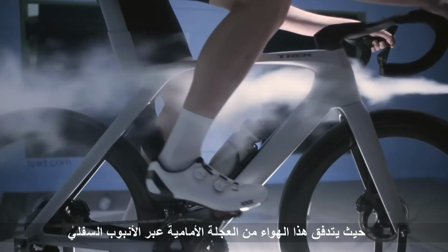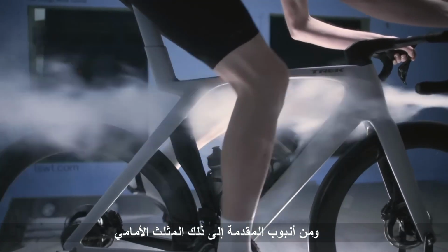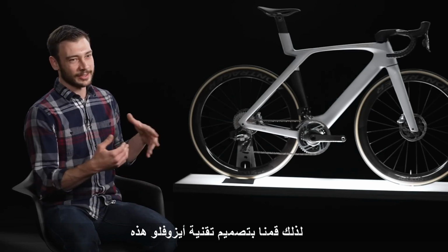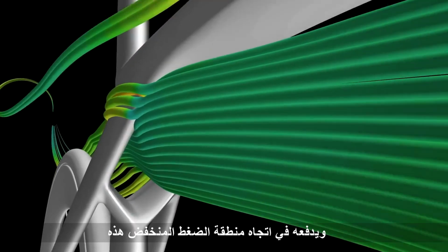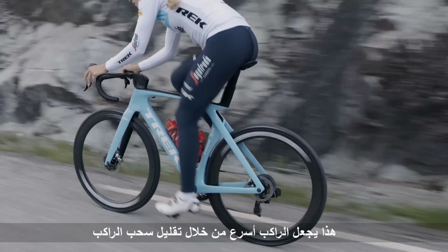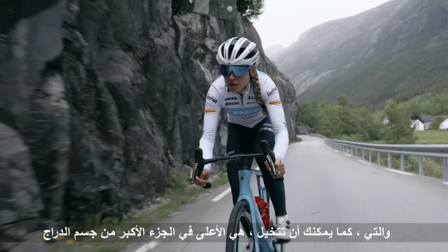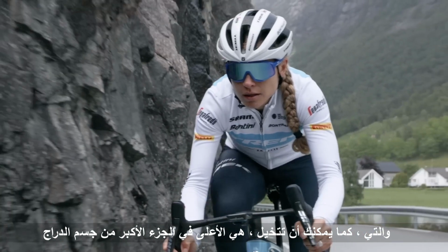As that air flows off the front wheel, over the down tube, and off the head tube and into that front triangle, the air is very turbulent in that region. So we designed this Isoflow technology that actually channels some of that turbulent air and kicks it into this low pressure zone that's behind the rider as they're kind of plowing through the air. This makes the rider system faster by reducing the rider drag, which, as you can imagine, is highest on the largest part of the rider body.